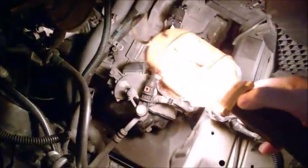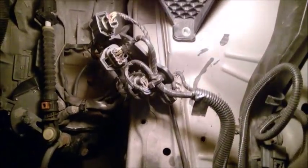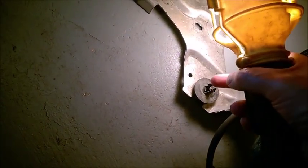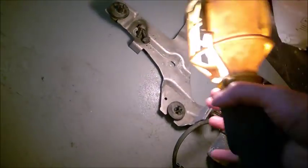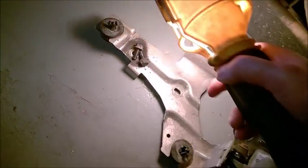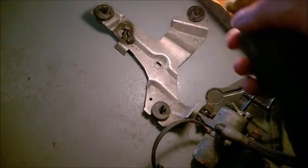The airbox has three clips. They are on the bracket here, which I also did remove, has three clips like this. You can get a 10 millimeter socket and a long extension and just grab over those teeth, press downwards a little bit and then lift. But you can also just pull strongly and it's going to pop out, going to break the teeth, but that's really not important. You need to undo this bracket from there. It's a 12 millimeter box bolt.